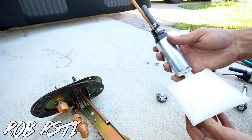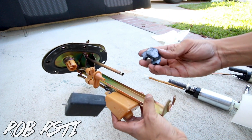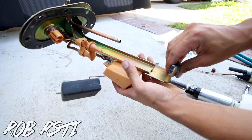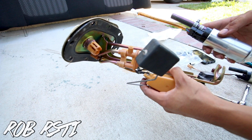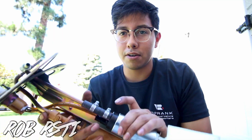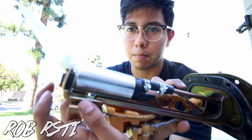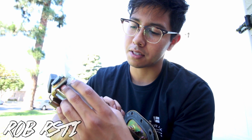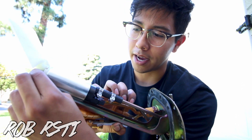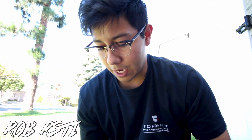There it is — the Walbro 255 all put together so far. Now you literally just have to put the rubber grommets under the fuel pump and then drop it in. One thing you guys would probably have to do: the middle tabs at the bottom — you'll have to bend them out because the rubber grommet is brand new and it's kind of hard. Once you put it in you can bend them back so it stays in place. Everything's plugged in, plugs are tightened up and plugged right in. Pretty happy with it.